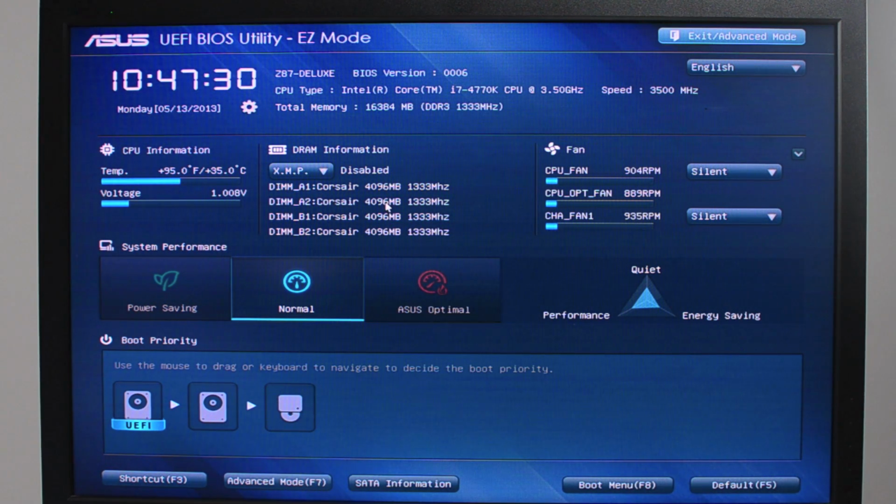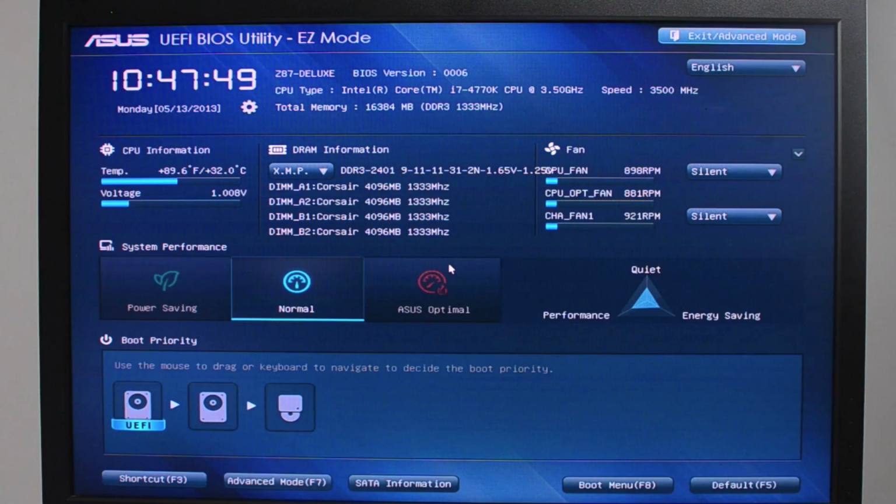So we wanted to find a way to make this easier for the user to just pop in here and enable it without necessarily knowing that you had to go into advanced, the overclock section, go into the manual parameters, and actually select XMP. So we now have a one-click option. The user can go to the DRAM, select the profile, choose to apply it, it makes that modification, and from there it's automatically enabled for you. So it's a much simpler process for users in terms of just being able to quickly enable the XMP profile.